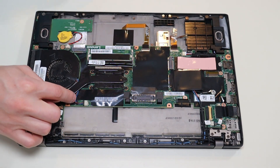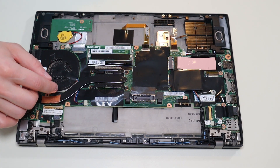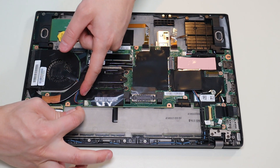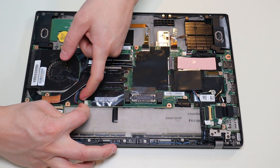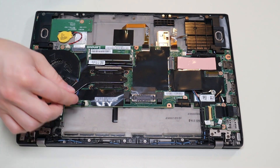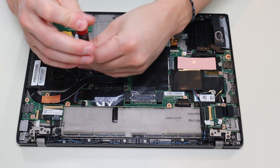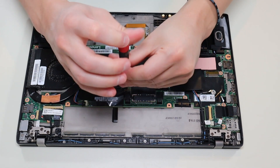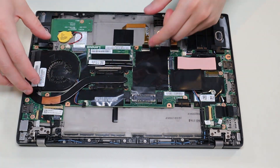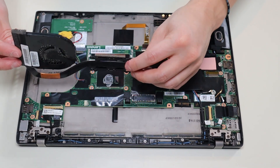When you unplug the fan, make sure you're not pulling on the wires. These fan wires are very fragile in most computers so you could damage it. Put your fingernails or a pry tool on either side of that plug and just pull that out, and then your fan wire will come out. I'll go ahead and remove these four screws here over the CPU. That released the whole assembly so it can come up now, and that's what you're looking at for your fan and your heat sink assembly.